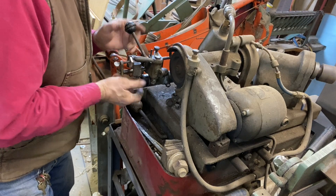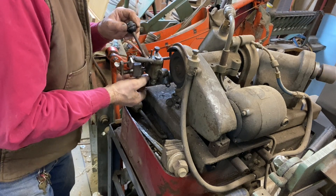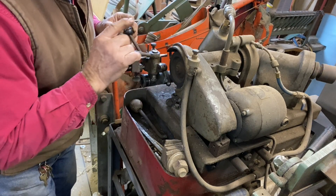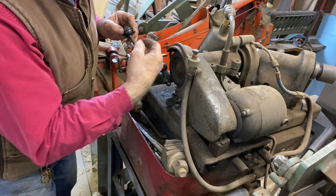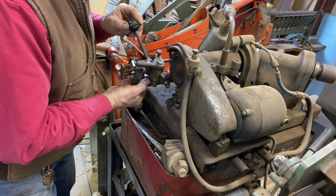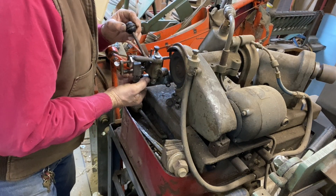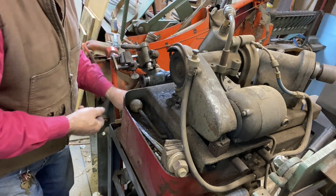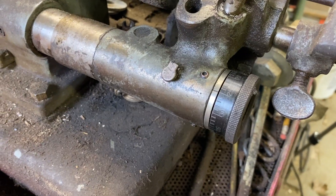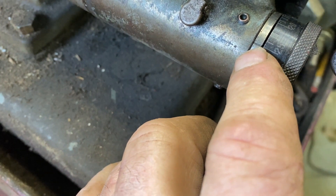So just a pass again on the 16, and now we'll turn this. 17 thousandths. You can turn in, go this way, turn in again and grind one coming back out too. That should be a total of 25 thousandths. If you look in here close at the adjustment knob, you can see my 25 thousandths mark is aligned with the zero.